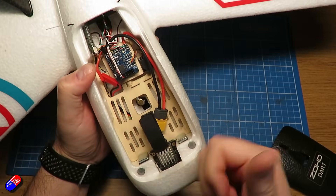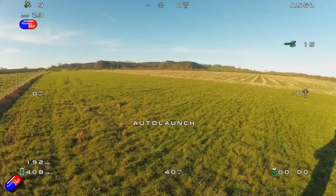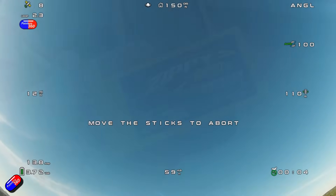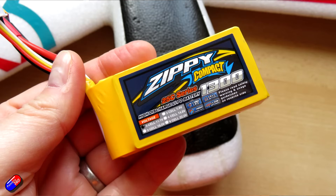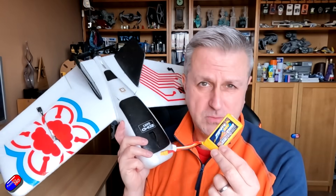However, it wasn't all good news. Back in the early days, these planes are incredibly efficient — not very heavy at all, and I could get about 18 to 20 minutes of flight time without breaking a sweat. But every time I added a little bit more technology, that flight time got lower and lower. In a recent flight, it was only getting about nine minutes out of the batteries I've been using. I've been using these Zippy Compact 1300s for ages — some of them are probably not that much younger than the plane itself.